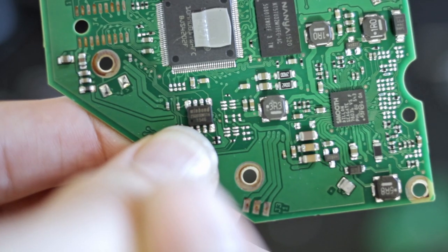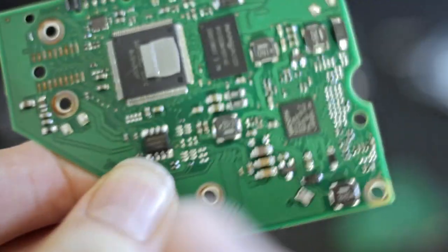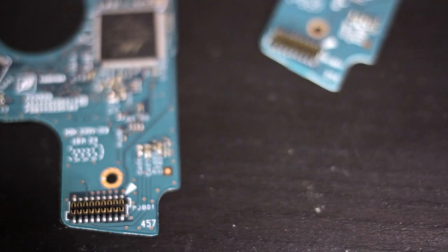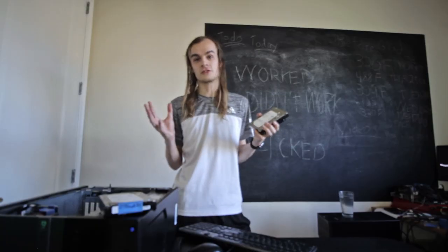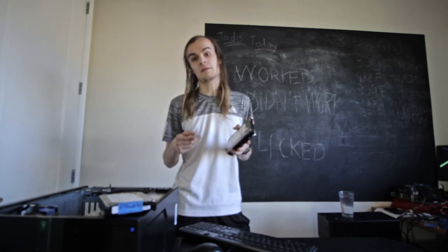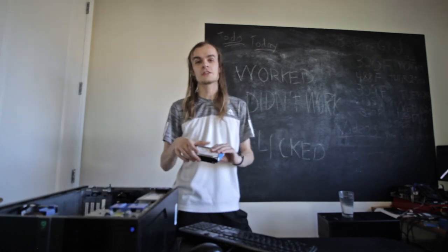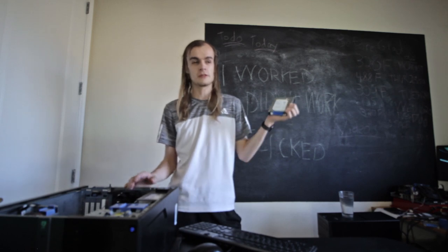Unfortunately there seems to be something on these boards — likely tied to the little ROM or flash chip — that tells the drive how to initialize the disk. This could also be due to slightly different hardware revisions that manufacturers don't tell consumers about, where small changes to the board or platter system prevent cross-reading. Thanks for watching this video on hard drives — subscribe if you want to see more videos on hard drives, servers, and other computer equipment.